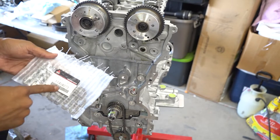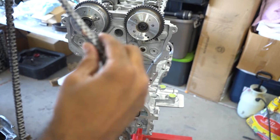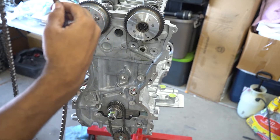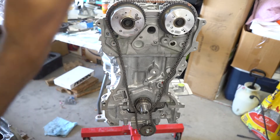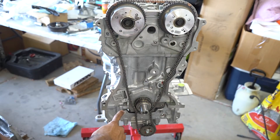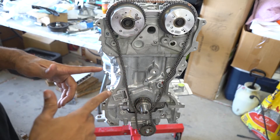Next we're going to install the brand new OEM timing chain along with the timing chain guides and the guides for the oil pump chain. There are copper-colored links on the timing chain which have to be lined up with the timing marks on both the cams and the crank. The four center links have to be right in between the two cam gears. After you get the chain on, confirm that all the marks line up: two with the top of the cam gears, the four links in the middle, and the one link matching up with the dot on the crank gear. Then put on the timing chain guides, oil pump chain guide, and the timing chain tensioner.